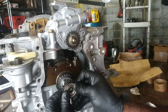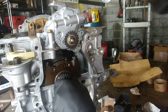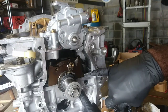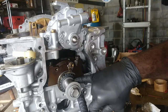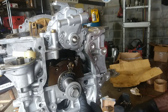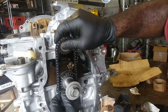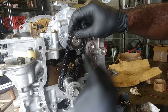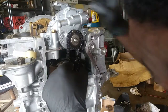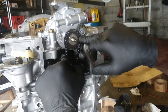So, where our timing chain is going to line up. So I'm going to put those right there. The key needs to be facing the exhaust side, and I'm going to line my mark up with my notch here, walk that on there, and everything's lined up. So once I put tension there, I should be able to put the little notch in there, and it lines up so I can see that hole just fine.